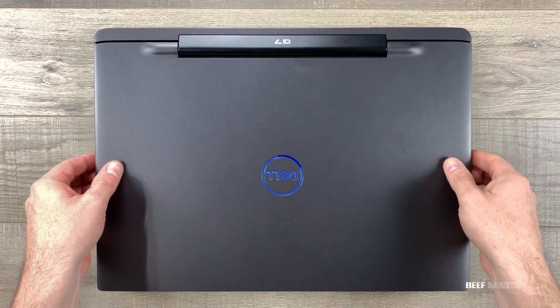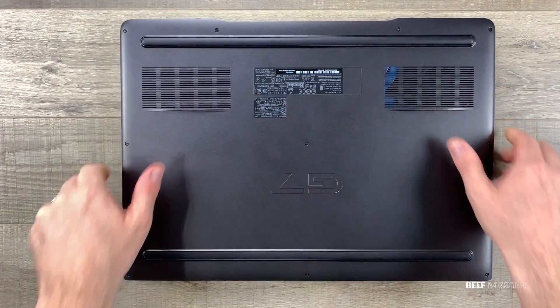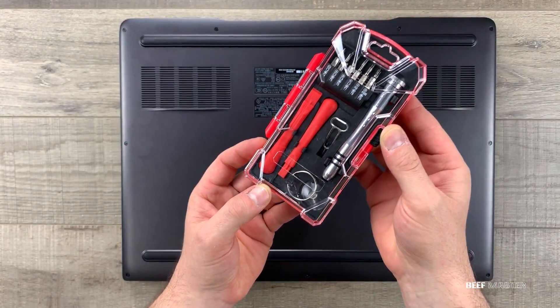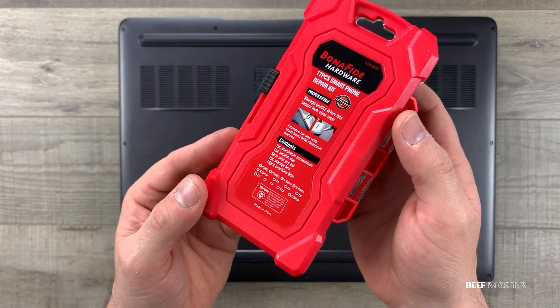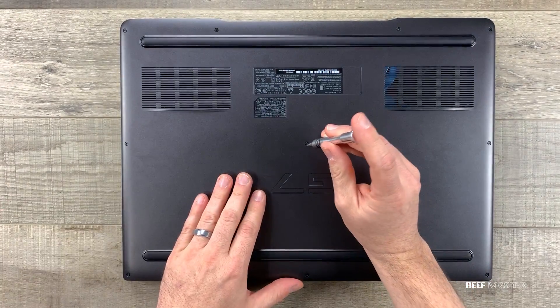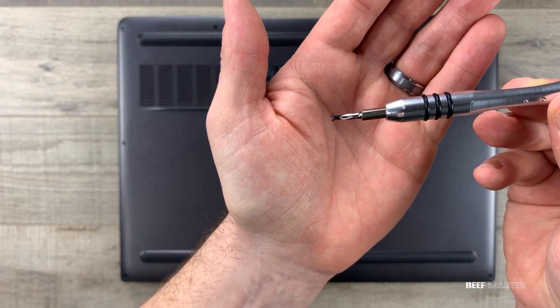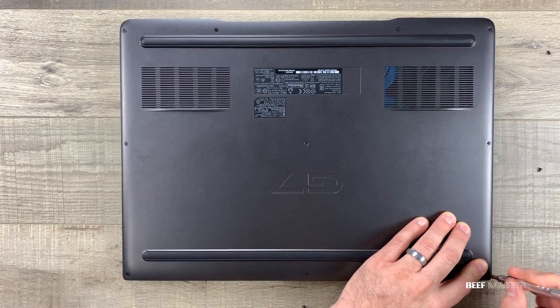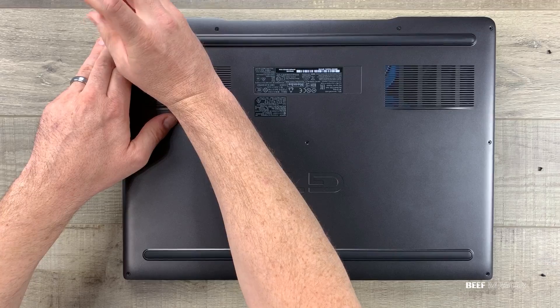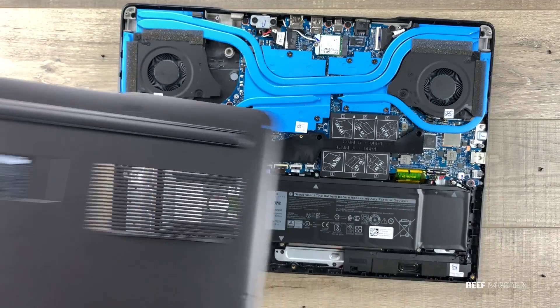Flipping it over, we see that the back is simple with two large vents. The sound from the speakers comes out the front around the edge. To open it up I'm going to use this bonafide hardware kit — it's my favorite kit and I've used it in nearly all of my videos. To take the back off we start by removing the screws, which are very small so be careful not to lose them. Like most laptops the screws are found around the outside edge. On the G7 there were none under the stickers, so I simply removed the outside ones and it came right off.